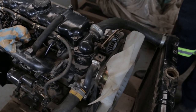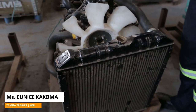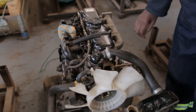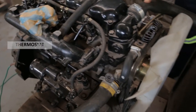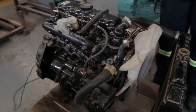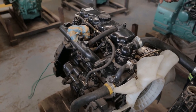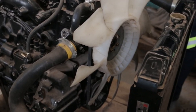I want to start from when the vehicle is switched on. When the vehicle is switched on, water around the cooling jackets will just be moving around and it will keep on running until it reaches the operating temperature. What maintains the temperature on the engine is the thermostat inside. Depending on the temperature set for the engine to operate, that's the temperature stamped on the thermostat — in some engines they are stamped 85 degrees Celsius, some are stamped 75, depending on the temperature set for that engine.